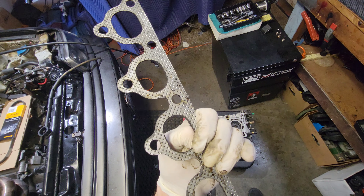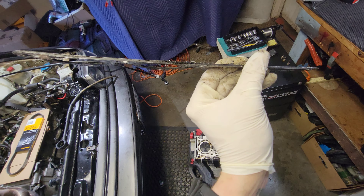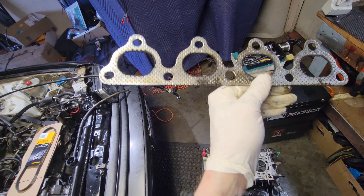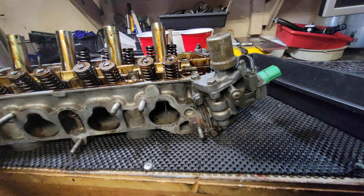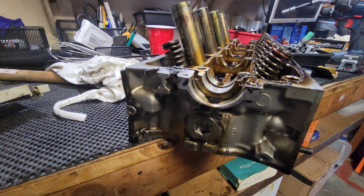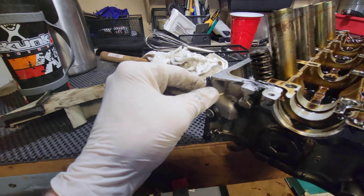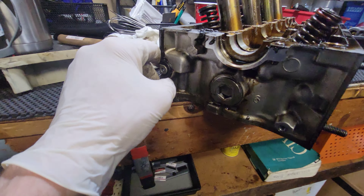This exhaust manifold isn't actually all that bad. I just see a few places that are a little iffy — we'll see, clean it up, might be pretty good. I don't see any structural integrity issues. I got a little drained up here. I think I'm gonna start with taking off the timing belt back cover, just some random crap — take everything off the head, get it all stripped down to just a head. I'm starting to find out where some of these gasket pieces go. This guy goes around the bottom there — looks like I'll get to use some of my gaskets after all.